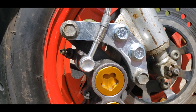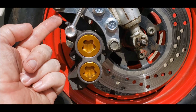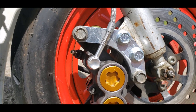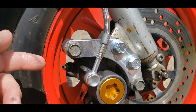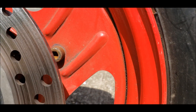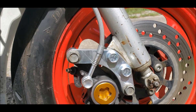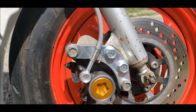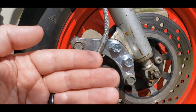If I had to do this again, I would try to rotate the entire setup clockwise a little bit — I think I could get a few degrees out of it, but this is my first one. Another problem was that the rotor could not be on the center line of the caliper where the pads are, because the YSR has wheels that are bolted together, and that caused interference and it wouldn't rotate. The first bracket I made happened to be centered and I thought it was great, but when I put it together it locked up after about 10 degrees, so I had to make another one and slightly offset it.